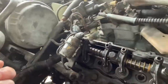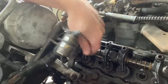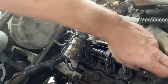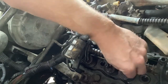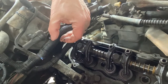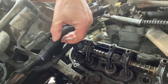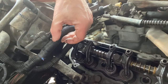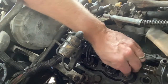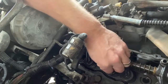Okay, not the easiest valve cover in the world to get off, but not the hardest - I've got it off. The two cylinders we're concerned about are this one and this one. I've already ruled this one out just by listening. What I'm going to do is roll the motor over by hand from the crankshaft - put a half-inch ratchet on it and turn it so I can get these two freed up. You can hear that little bit - that is tappet noise.